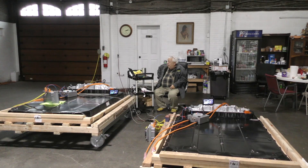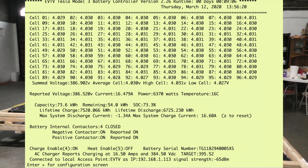We've done pretty well with the controller. These are the newer batteries that do not natively put out cell voltages, but as described in the last video, we can use the Universal Diagnostic Services Protocol over CAN — UDS — to request data from the processor in the high voltage battery, and it will give us each of the 96 cells and their individual voltages.